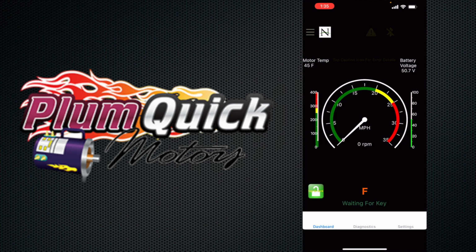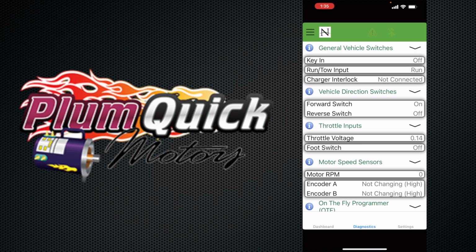Next screen we're gonna go to is the diagnostic screen. It says key in is off. If we turn the key on, it'll turn to on. The run/tow input is on run. The charger interlock is not connected. If we plug the charger in, it says connected. See that? I just unplugged it. The forward switch is on. If I hit the reverse switch on, those change.